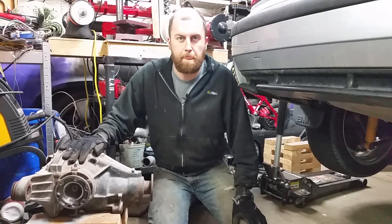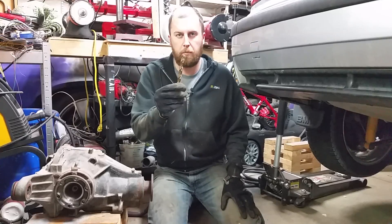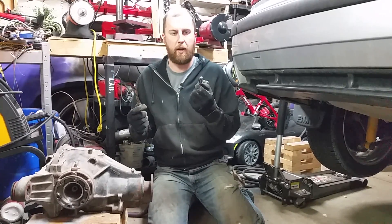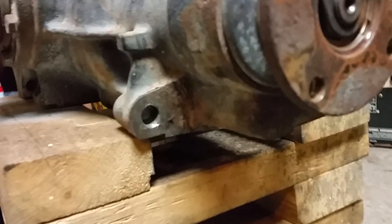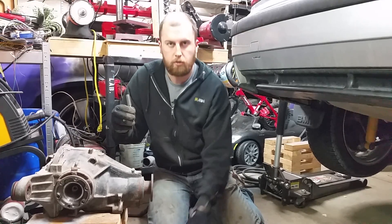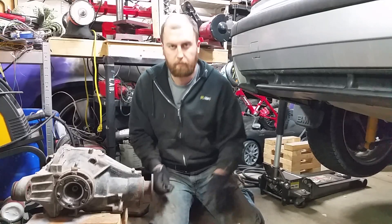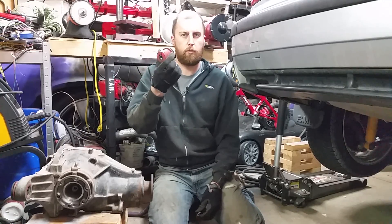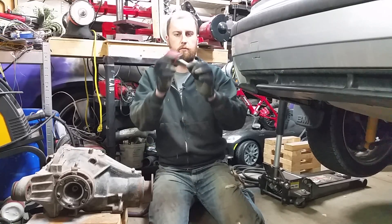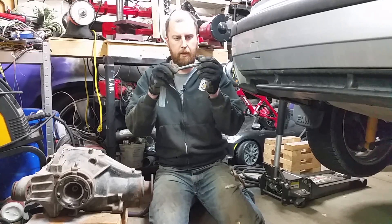It's pulled out, it's ready to drill. Step one: half inch drill bit. Half inch is the closest US size for 14 by 1.5 metric. I'm going to drill it out to one half, then tap. This is a 14 by 1.5 fine thread 14 millimeter tap, so it will fit this gargantuan 14 by 1.5 grade 10.9 bolt. Once that's drilled out I also need to drill out the bushing — it just needs to be large enough that the bolt can slide all the way through.